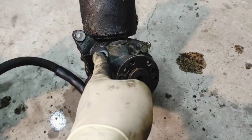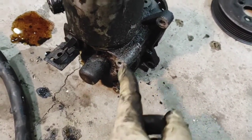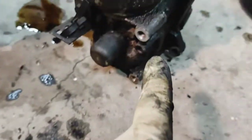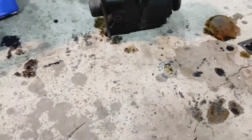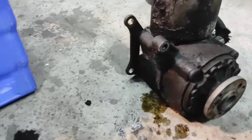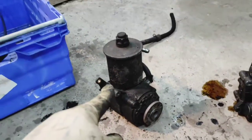The M103 engine has two joints here similar to the others, but it also has two bolts that go straight through the center into the aluminum timing cover housing. On the 606 they've done similarly - two bolts, plus this little bracket going off that allows it to go straight through into the side of the timing cover aluminum molding. So I'll be able to just whip that off and pop it on perfectly.